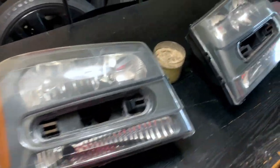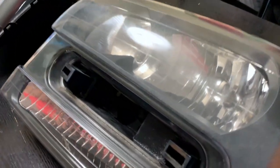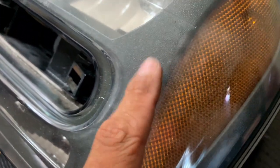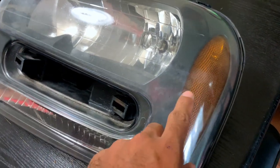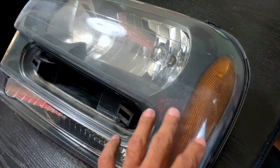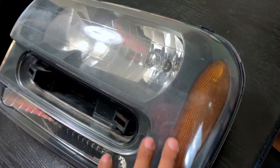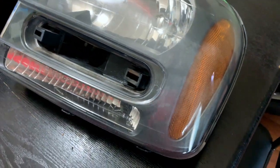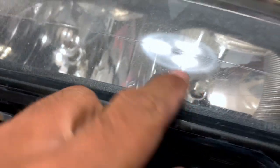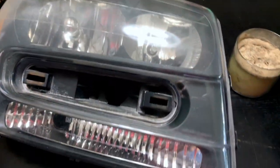Here's the finished product. With the new light you can definitely see the imperfections I was talking about. Come to find out, what I thought was on the surface is actually some of it on the inside — especially over here. Where that comes from is when your headlights get fogged up or they have a leak. If that leak gets trapped inside, they haze up from condensation. Over time the condensation does disappear, but it leaves watermarks and starts to haze up your headlights. Some of that stuff is on the inside, but a lot is also on the outside — and you cannot get this stuff off unless you really go heavy with the wet sanding.